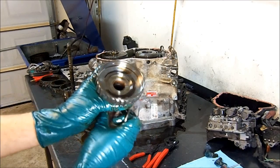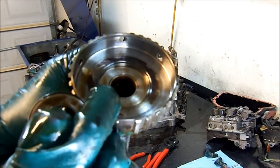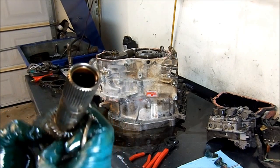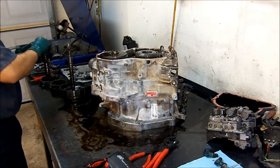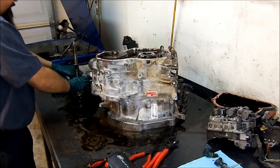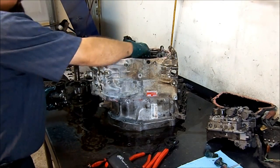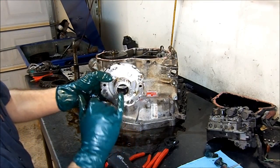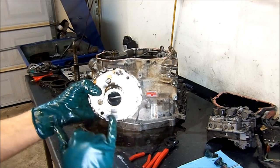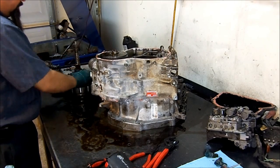You can see a little bit of wear on this bushing, and it actually looks better than the one on the opposite end. This planet here is in good shape. This bushing likes to spin — before it wasn't available and you had to send the whole planet to an Omega machine shop, but now the bushing is available and you can replace it.